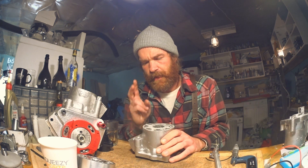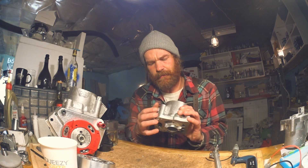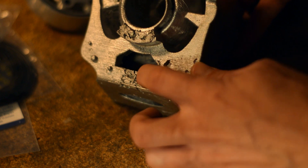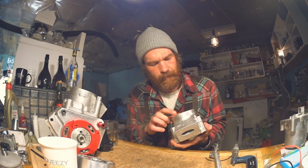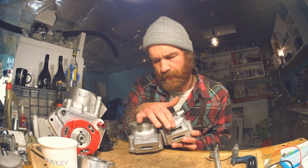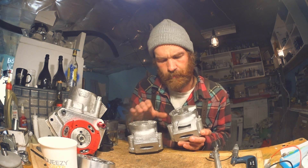I've started thinking about casting again. I've had two main issues. The first one is plaster intrusion into the 3D printed models — they're not sealed good enough, you can see it here. The second problem is getting that plaster back out of there, as you can see here too. I put that window in there to be able to scrape the plaster out or blast it out with high-pressure water.